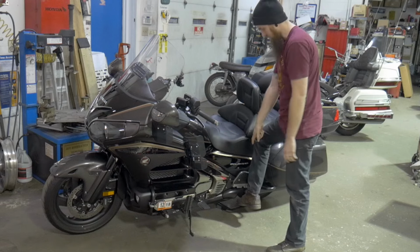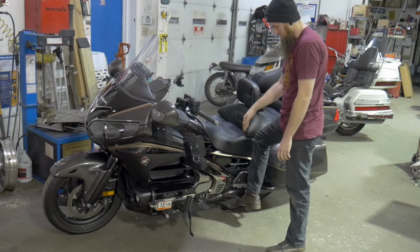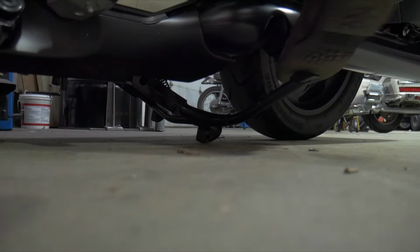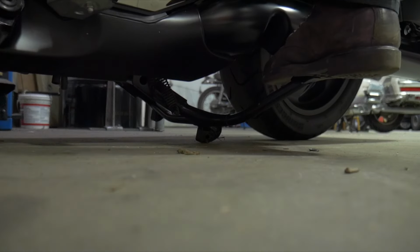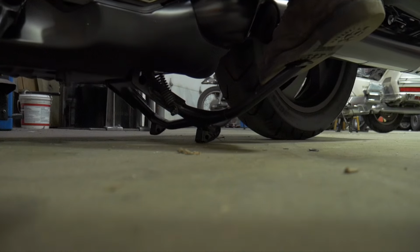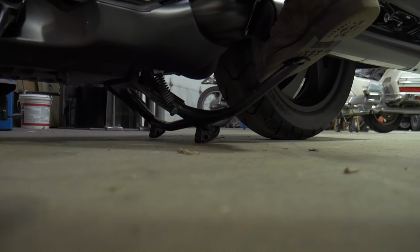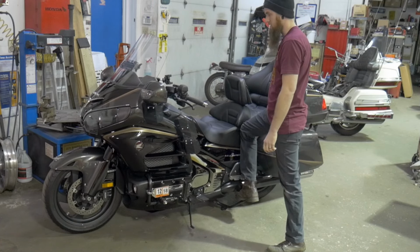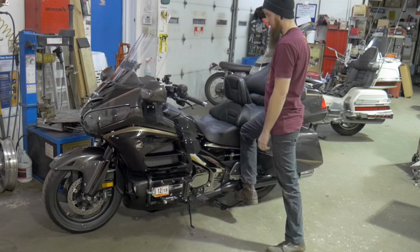All right. Put the foot of the center stand right on the ball of your foot. Okay. I'm going to lift it up, and what I'm going to do is try to locate those 2 feet. So right now I'm rocking on one foot, and if I find that other foot, I can get it to rock back and forth. Once you've located the 2 feet, the bike will pretty much sit in that center line position.